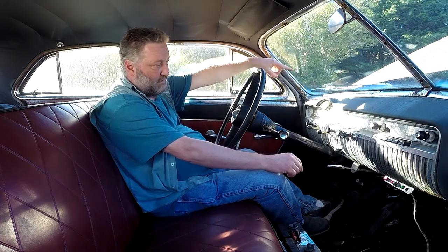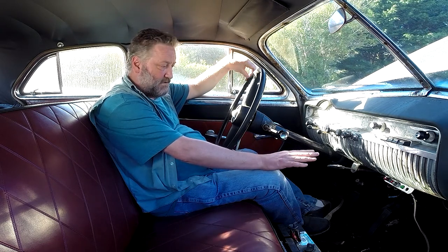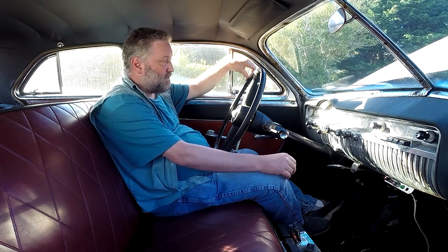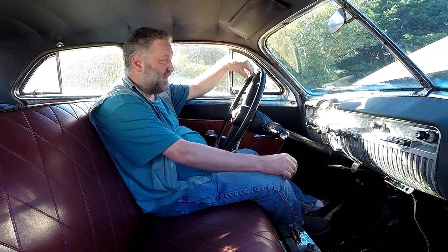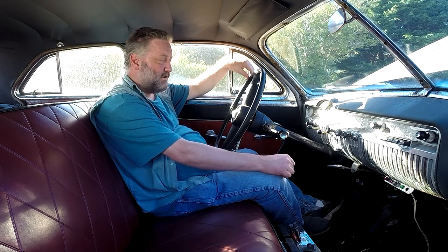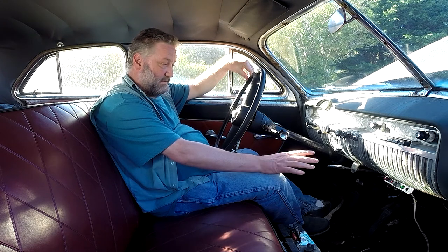I was having problems getting that button to activate the ignition solenoid and then send power to the starter — that just wasn't registering. So I hit it a bunch of times; I suspect there's corrosion. And it started, but it was making a rattling noise. I thought perhaps it was the hood, which, like I say, was not locked down entirely — just resting on the emergency hook. I was pretty sure I'd started this car before with the hood not fully latched and didn't recall that noise ever.